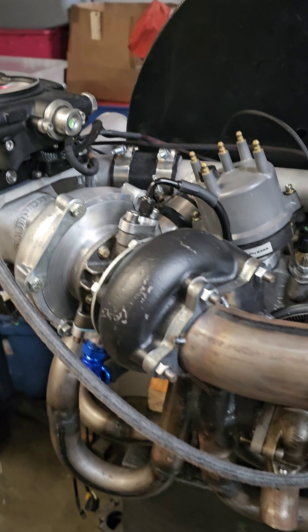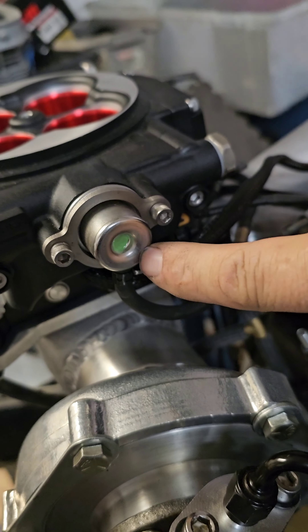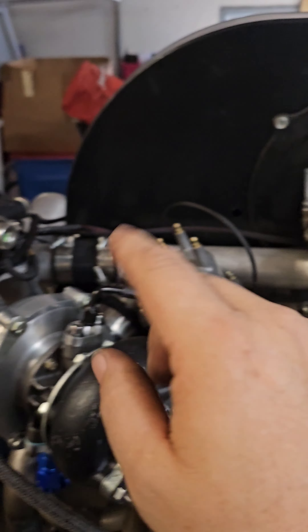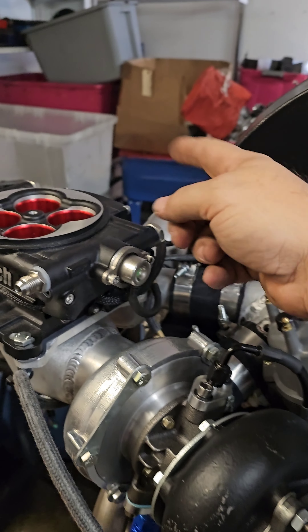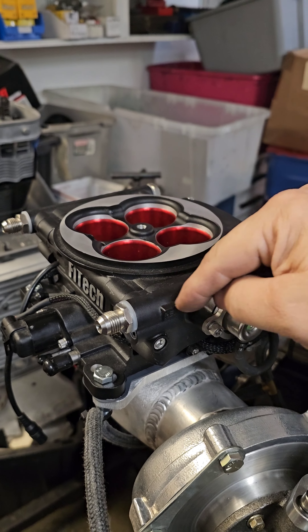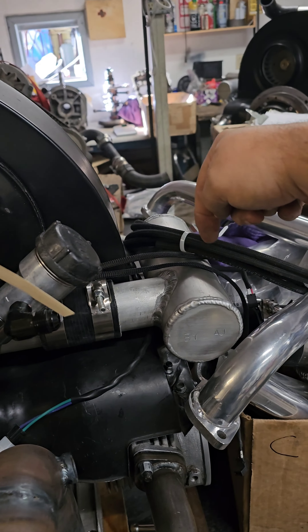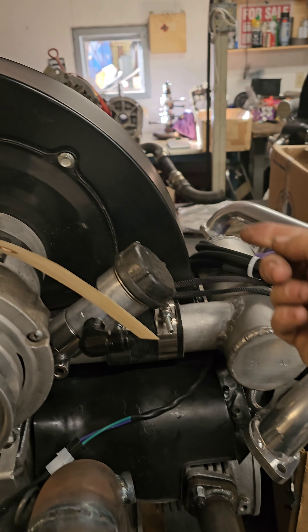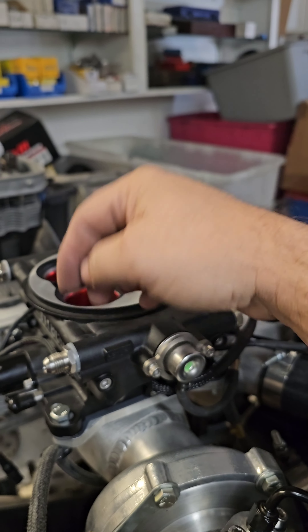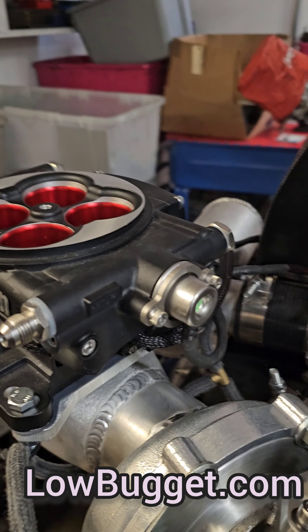You can see as it goes up it tees into another one that goes over to the regulator, and then the other one goes over back there. Even though this is port injection and it's going to have injectors on each side, the fuel is still going to go through the throttle body to take advantage of the regulator. The fuel is going to actually come in back here — this is the return — and then go back out. What's going to happen is the fuel comes into this injector bank, into those two, comes across into this injector bank, goes across and then into here, through the throttle body — which isn't going to use any fuel up here — and then out of the regulator going back. So it'll be regulated.